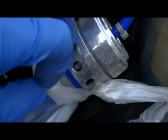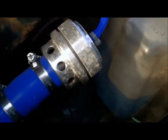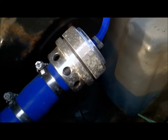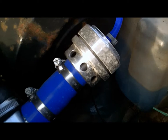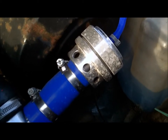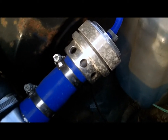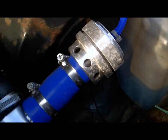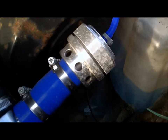The only way I can tell that there is some pressure releasing is with a very thin plastic bag tied to the valve, which seems to be releasing some pressure, but I'm not convinced it's releasing all of the boost pressure. There doesn't seem to be a massive difference on the throttle, and it's completely inaudible with the bonnet closed — certainly when driving it. When you've got your ear up to it, you can only just barely hear some movement with air. So I don't know whether I need to do the valve upgrade to make sure that all the pressure is being released as it should be when the switch is activated.